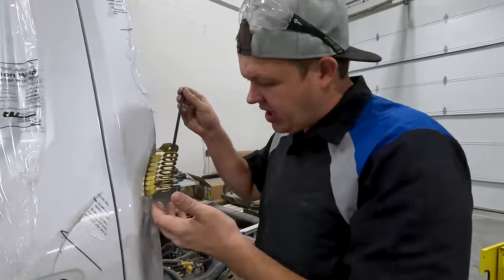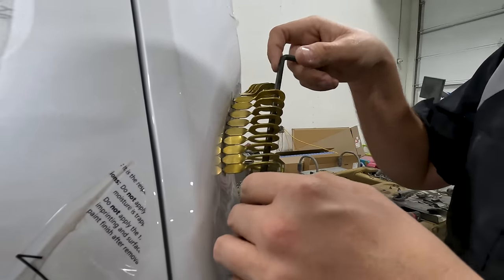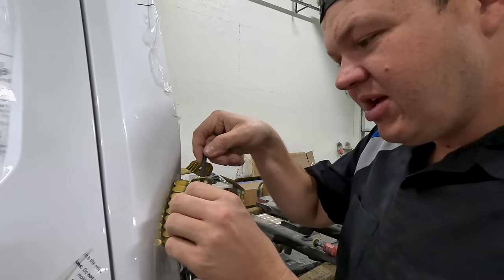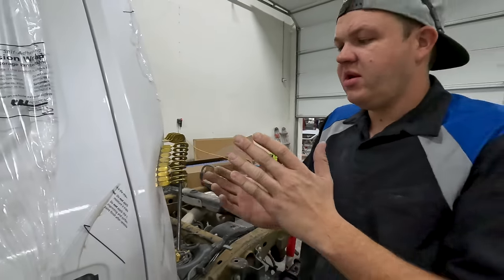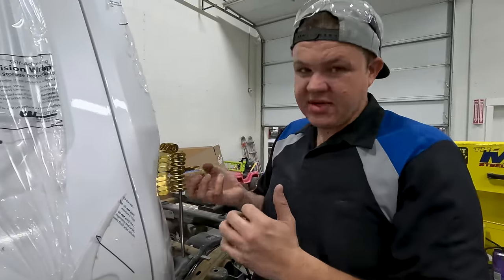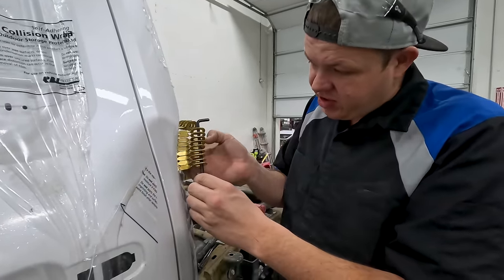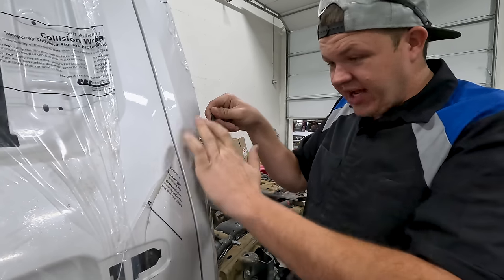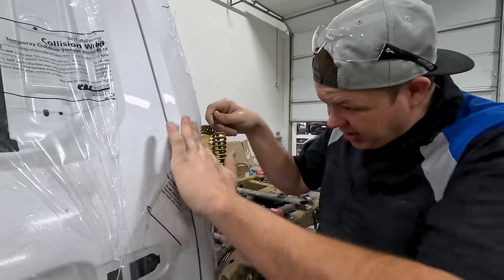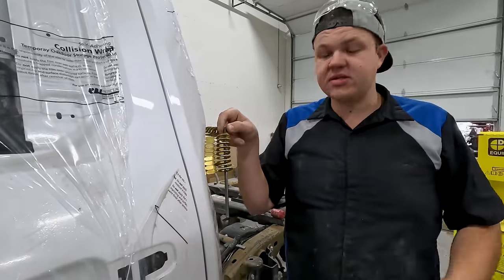All right, so here we have a rod and you can see the rod only attaches to the lowest point. So as you're pulling, it'll start pulling tabs around it. That's the whole point of this key pull system. You're not pulling all of that at once. You're putting pressure in the center, you're pulling the lowest spot, and as it comes out, it pulls the rest of the keys. As we put pressure, I'm gonna be able to tap this eyebrow out of it. And you're gonna be absolutely in awe at what this will do.